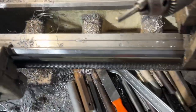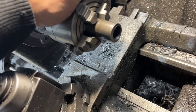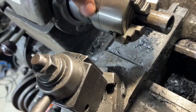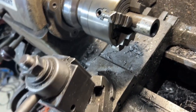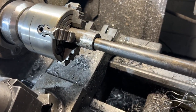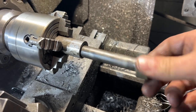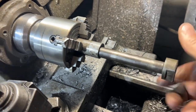I just kept stepping up the drill bits one or two at a time. I really didn't want to put too much pressure on this, mainly because I don't love this Chinese four-jaw chuck, but it did the job. Then we could see how our shaft is going to fit — that's perfect, very nice.